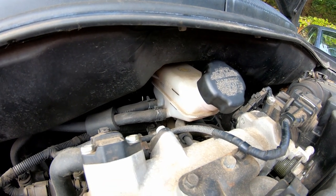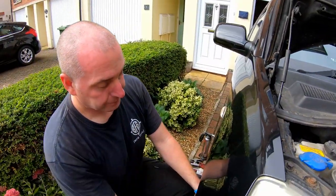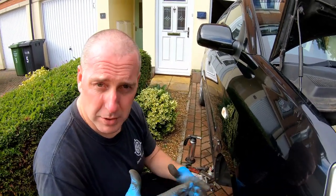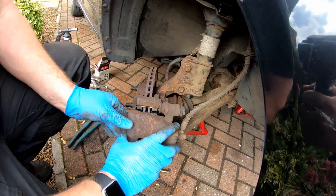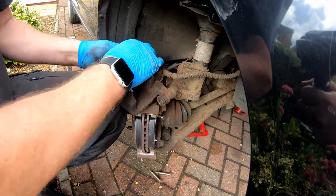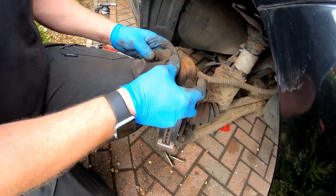It's not too bad on this one, but on some cars if you do this the brake fluid can actually overflow out of the filler cap and end up all over the engine. If the fluid level goes over the max once the caliper has been refitted and you've pumped the brakes to reseat the piston, just withdraw a little bit of fluid with a syringe and everything will be fine. We've got the piston back in where it needs to go, and we just need to make sure the sliders are nice and free — there we are, that's free as well.